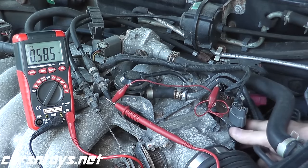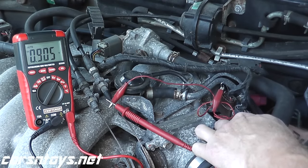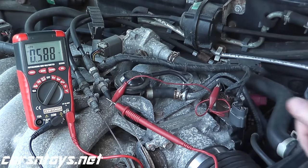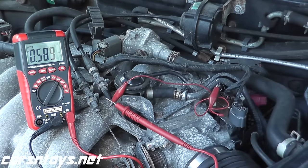But let's say you were off — just by rotating this sensor you can change the reading. You could be too high: 0.9 is too much, 0.8 is borderline. Right about here is the sweet spot. So I'm going to leave it just like that, tighten down the screws, and that's it. This car is ready to go.